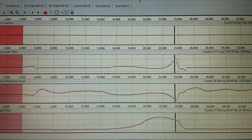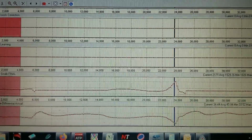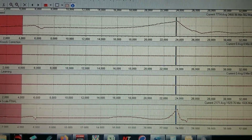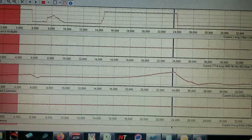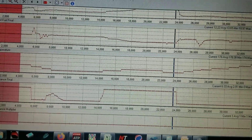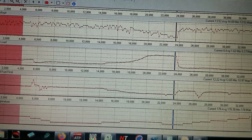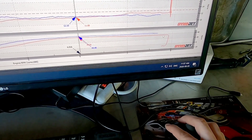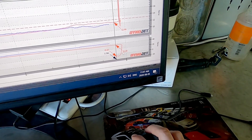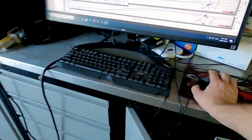We could still do a little bit of work on the fuel system to make that a little smoother, which would give us a little more headroom for even more boost potentially. We could lower the ethanol content which would reduce our demand, but I don't think we want to do that — I like the ethanol where it's at. Now you can see no knock, and I am using knock sensors. This is a street car so knock sensors are active. Engine speed on that pull: 7,800 RPMs. Dynamic advance is good, everything is looking good. Coolant temps nice and cool. Calculated load is up there — calculated load usually follows torque pretty close. My boost was peaking before at 41 pounds then dropping off to redline at 35.29 pounds, so we wanted a lot more boost up top. Now we're making 43.3 up top instead of 35, so we're making 7 to 8 pounds more boost.